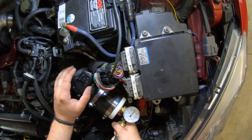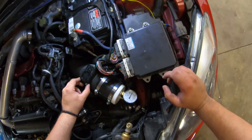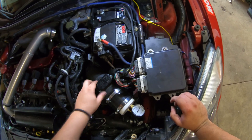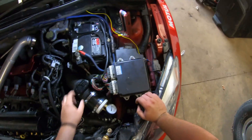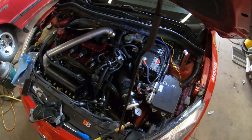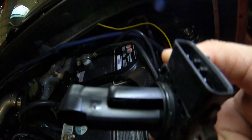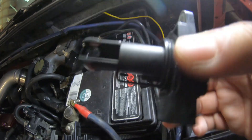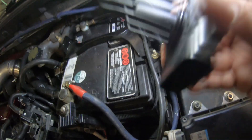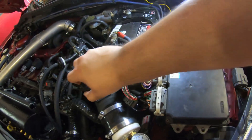Our MAP sensor o-ring is leaking like crazy — that's big-time no good on these cars. I'm going to take it out and see if I have a replacement o-ring in the shop. This leak is going to cause nightmares when the car runs, and it's actually pretty common on these — the o-ring just goes out. The o-ring itself looks okay, there's a little spot but it's just dirt. I'll clean it up and re-seat it to see if that seals it. It's held in by two allen-head bolts, and it's kind of a friction fit — pulls right out.